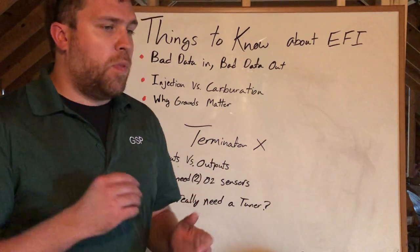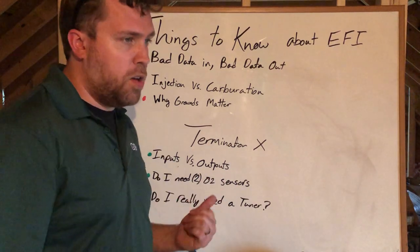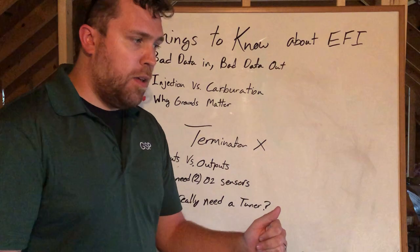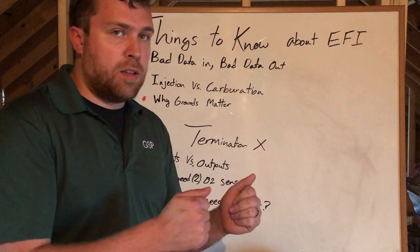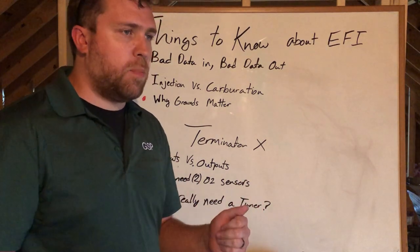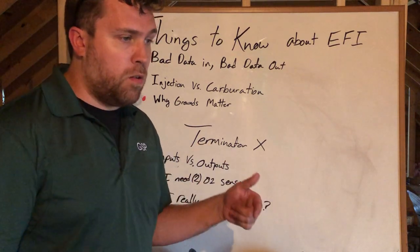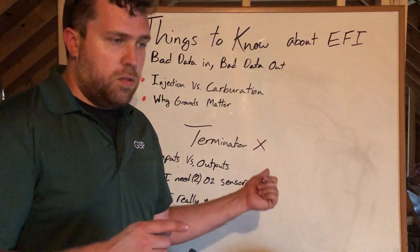Outputs, on the other hand, are for when you want the ECU to do something for you, and sometimes outputs are based on inputs. A good example is a clutch switch or push button for a rev limiter, trans brake, or bump. When you hit the trans brake input it functions an output that controls your trans brake using a relay. If you hit the bump button, that input controls the trans brake output to pulse it so you can walk the car into the beams. A rev limiter doesn't require an output — the ECU just uses internal functions to cut spark, throttle body, or fuel depending on how you have it set.